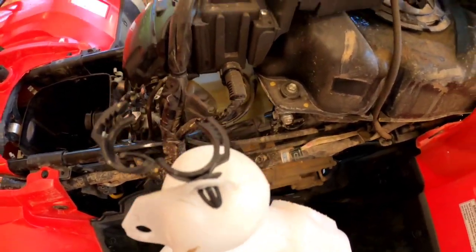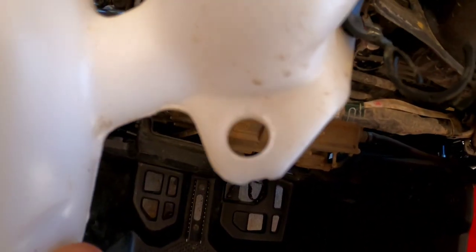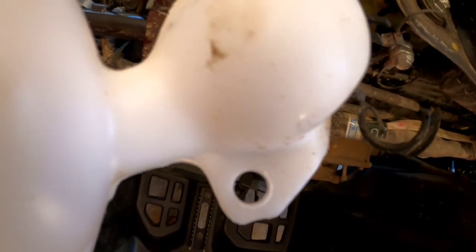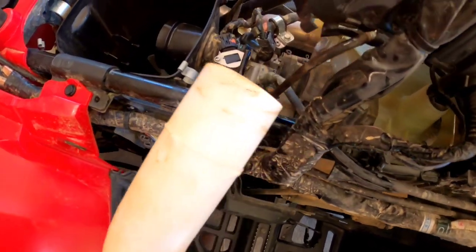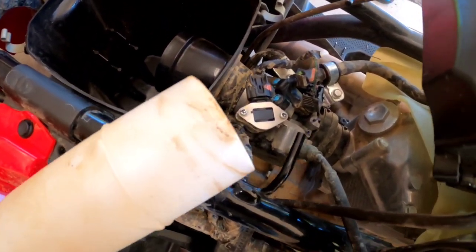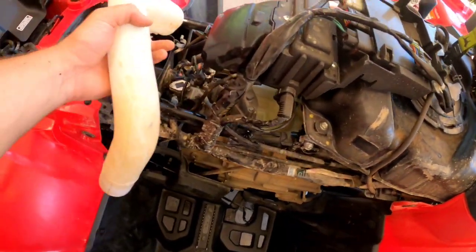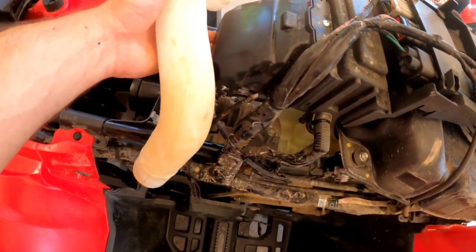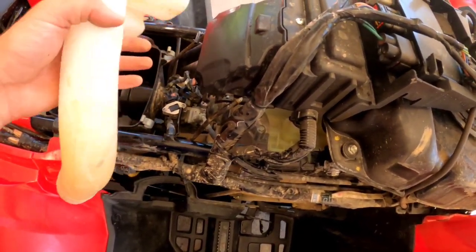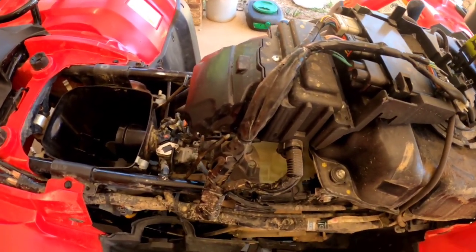It has a little clip that goes around the wires right here - you'll just want to pop that off. It's also got a plastic rivet you'll pop out, and you'll unscrew the fastener that holds it into the airbox and pull it out. You have to kind of prop on it, twist it back and forth until you can get it out. It's kind of hard, but if you work at it for a minute you'll get it.